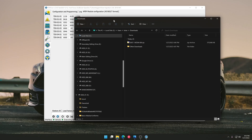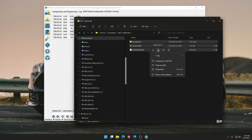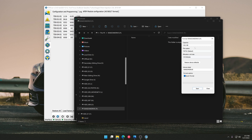I already have my flash drive connected to my computer and I already have the file downloaded. Everything that you need will be in the description below. And while you're there, make sure to leave a thumbs up and subscribe to the channel. So what you can see here is we have our downloads open with this file right here — it's called EA5T-14D544-BA. We're just going to extract this and you're going to get all these files. Then we're going to format our flash drive to exFAT and call it Sync 2 Update.